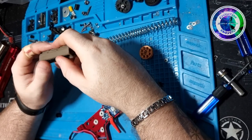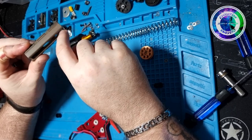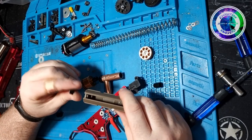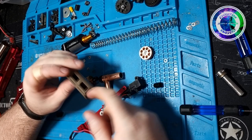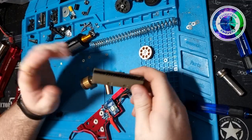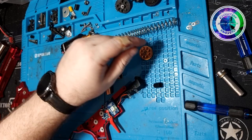This is just simple advice I'm hoping can help somebody. With the Aztec piston, on the inside I'll mix a little bit of JB Weld — basically fill up the channels that the rack sits in — then go ahead and get rid of all the excess. I like to use an old toothbrush and just brush out all the excess. You don't want the excess drying and splintering off and going through your gearbox — that's if you've used too much epoxy, so be careful of that.